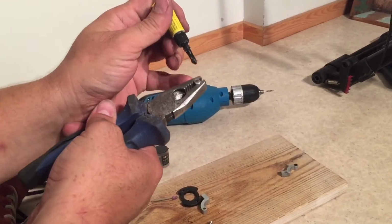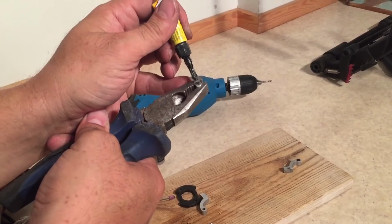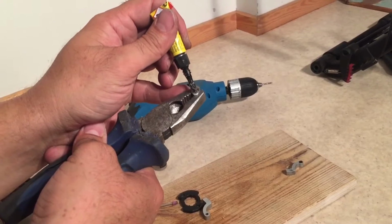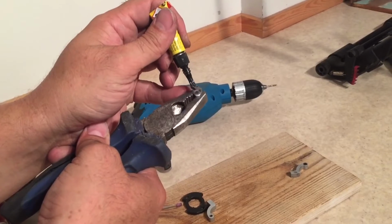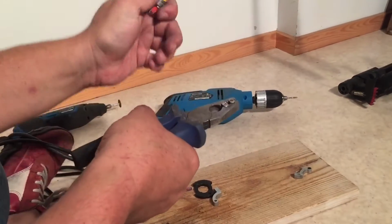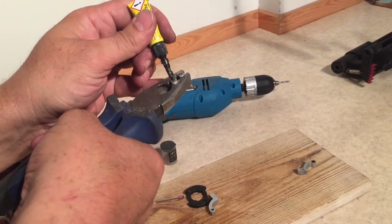Sometimes you get unlucky with rivets, and that might have been you, and you've been having trouble with that central pin of the rivet the whole time. But usually I find that it's okay just to glue it at this stage of the process. You might have to glue a bit throughout as you're doing the other parts that we've already covered. I just want to put a bit of glue, and then it's just gonna run down. I'm actually gonna slip this piece right into the same pair of pliers. I don't want these to stand upright while the glue works its way downwards.